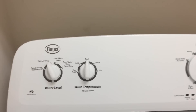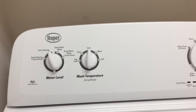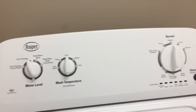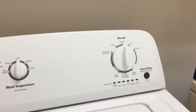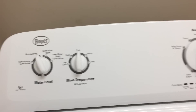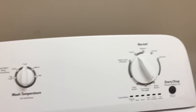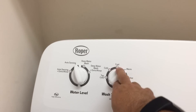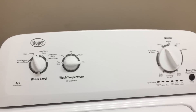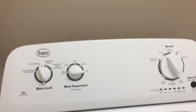What I didn't realize and never would have expected is that warm and hot are neither. It's partly the temperature setting and partly the cycle setting. On this washing machine, the hottest you can ever get is to set it on heavy — not regular, but heavy — and set it to hot. Even then, it's temperature-controlled so the highest it can ever be is 115 degrees.